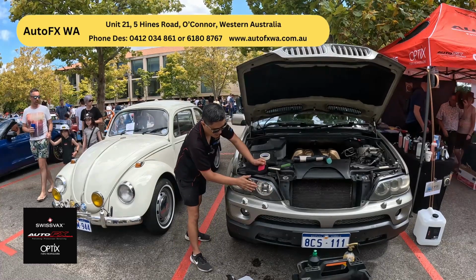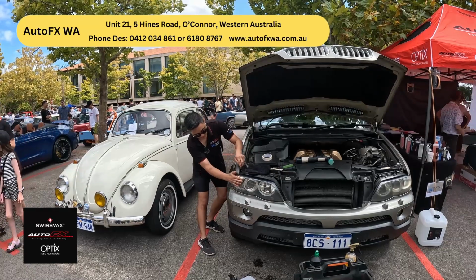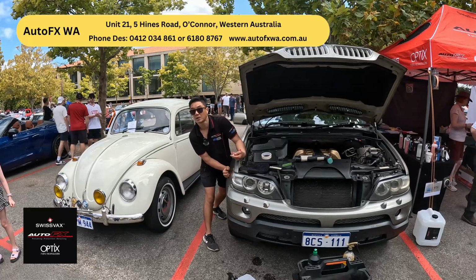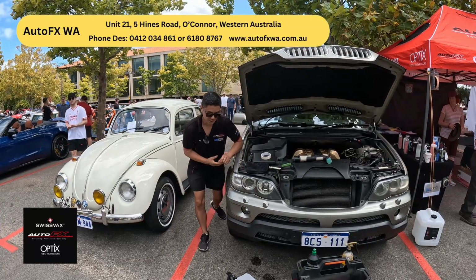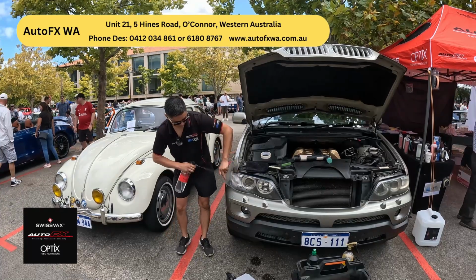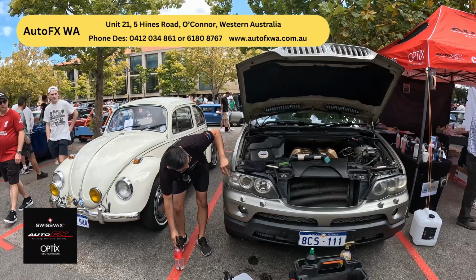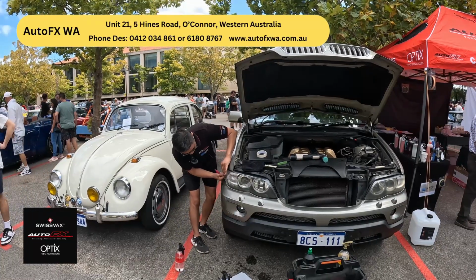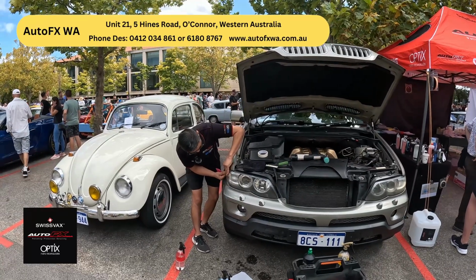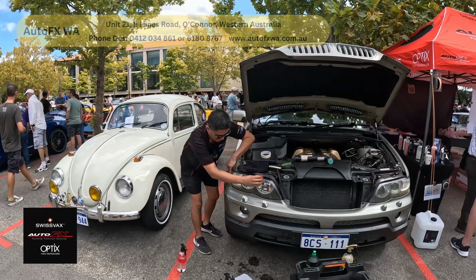Now we're just going to test that that's locked in. I can tell that that's locked in, it's not moving. So because it's not moving, now I can get rid of these fingers here by stretching that, because the more you stretch that, the more the fingers go down. When you let go, when there's not enough tension, the fingers show. So now we're going to flush out the soap on this side, so we can get it to lock in, stretch a little bit, and then we're going to squeegee out the rest of the soap and the water.